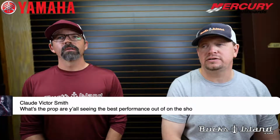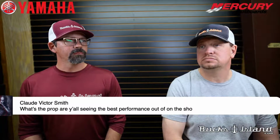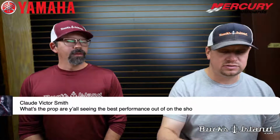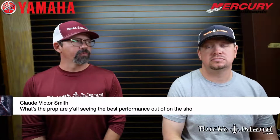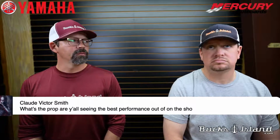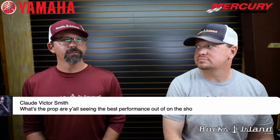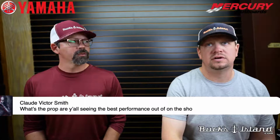Anything different as we get into the colder months? Yeah, you should be able to run a 26 if you fish winter tournaments. How much performance difference would you expect out of that one? Probably a couple miles an hour. Some of the newer FXs seem to wake up in the wintertime, so you could see 4 or 5 miles an hour difference. You get a little more grip in the wintertime anyway, and the air's got a lot more oxygen in it, so you end up having a little bit more horsepower.